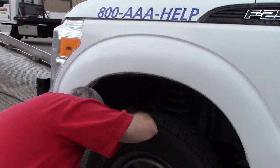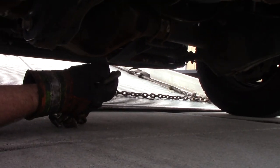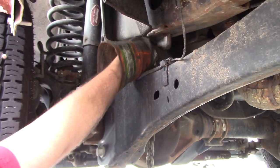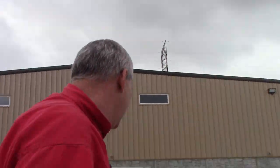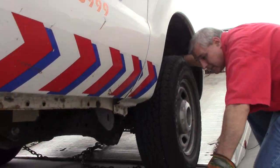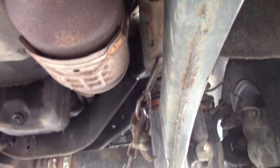Let's get back in here and talk the chains back and see what there is to hook to on this one. This one's got a hole in the frame up there that looks like we're going to tie down to. When you're hooking on these you want something solid — usually these hook points in the frame are really nice. There's also ones on the control arm that could be used, or you could come back further on the frame. On some Ford vans you've got to go back a little further.